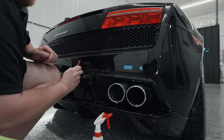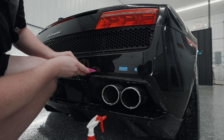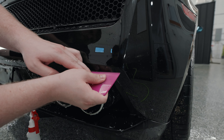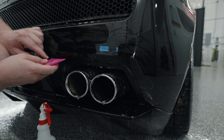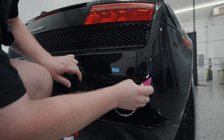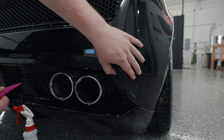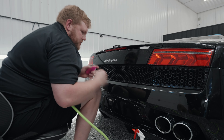Now we're going to come over here to the passenger side. I'm going to start on the very top and pull all the solution down and out the bottom — very lightly, with my squeegee angled downwards so all my solution goes down, just changing angles going back and forth. These sharp body lines right here are notorious for being traps for moisture, so you just want to go a couple more times back and forth over it to make sure nothing is left behind. There we go. Now I can lift this film up and flush out the slip solution that's underneath the film. I'm just using my thumb to get that film to lay down, then coming back with my squeegee to lock that into place. The film is popping up a little bit, so I'm going to get some more tack solution behind the film — and there we go. Now we can start moving over to the driver's side.